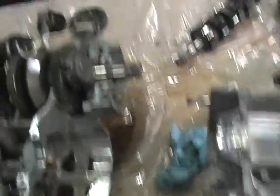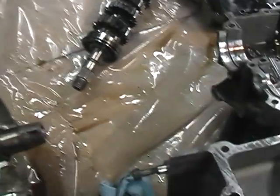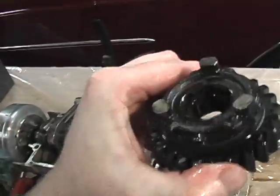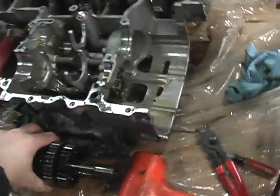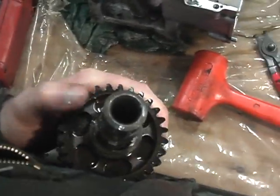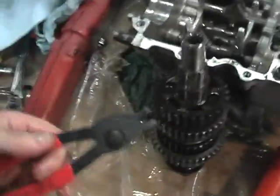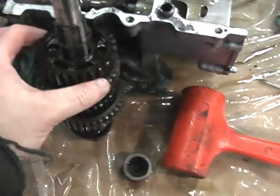I've already taken off these two outer wheels and gears. This would be an example of what an okay dog would look like — nothing fancy about that. I'm just laying them out in order. The next gear is held on with a snap ring, so you need snap ring pliers. You expand the ring and slide it off, and then you can get this gear off as well.